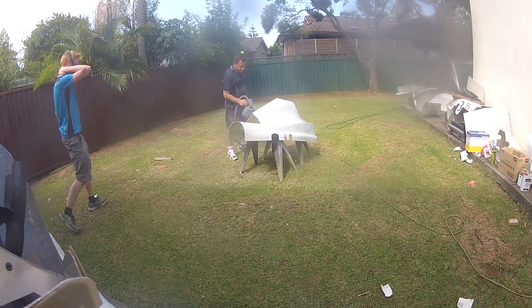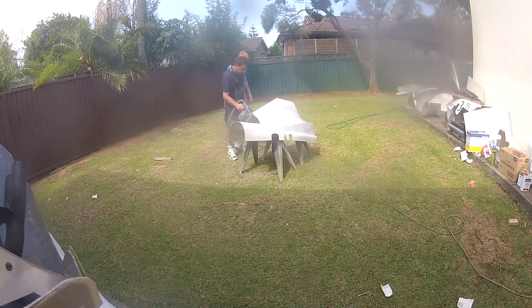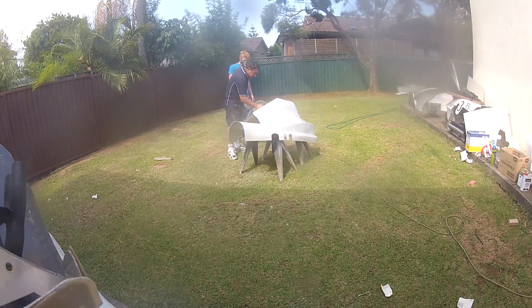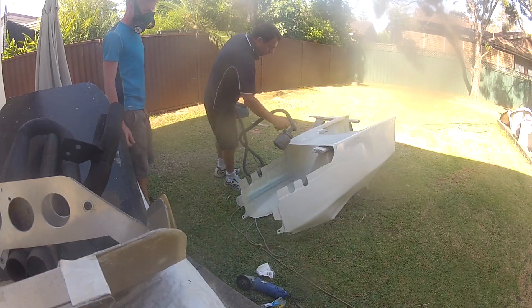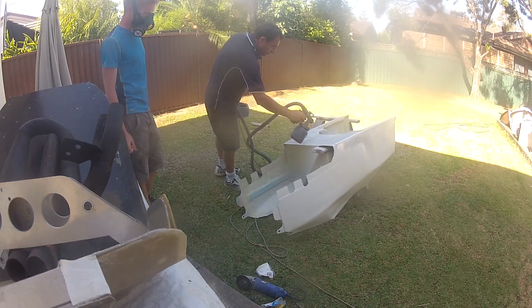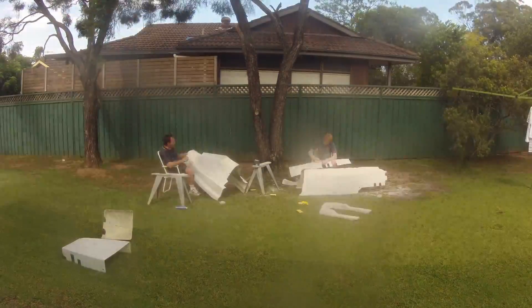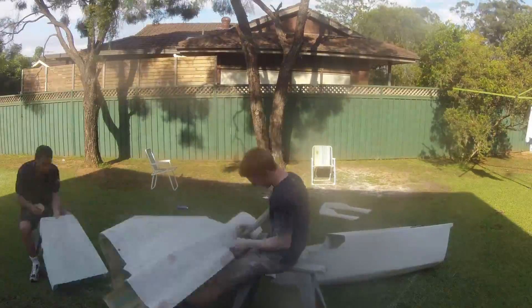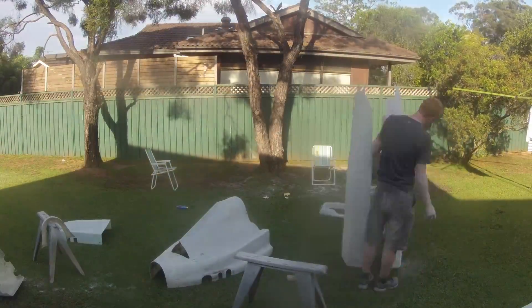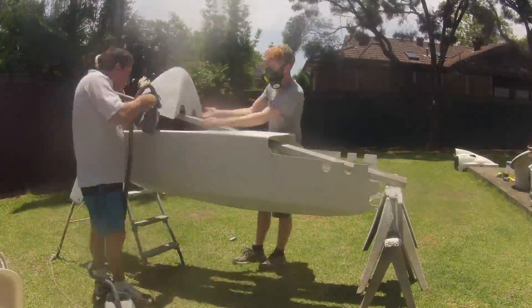I brought the bodywork to his place and we started preparing it for painting. He was pretty dissatisfied with the job I'd done and had no qualms with letting me know that. We set to work under Ray's direction, improving the parts to a point where he felt it was ready for painting. We started by putting a layer of primer down to get ourselves a base to work from, then set to work sanding it back basically to the fiberglass. The aim was to fill in some of the tiny imperfections that would show up if the top coat were to go down. This began another repetitive cycle of priming and wet sanding that lasted many days.